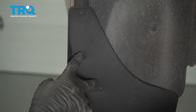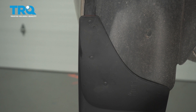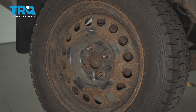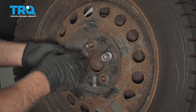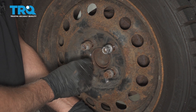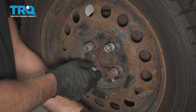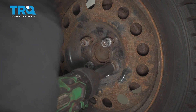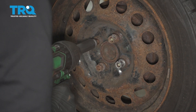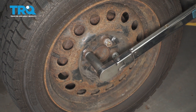If you have to make any adjustments, you can take the two bottom screws out, adjust it, and then reposition the screws. You can do the same on the other side. Put the wheel back on and put the lug nuts on. Now I'm gonna torque the lug nuts to 100 foot-pounds in a cross pattern to tighten the wheel down evenly.